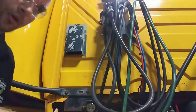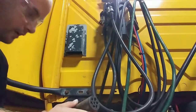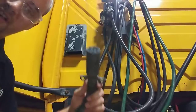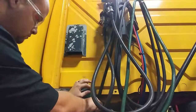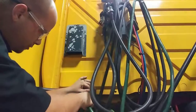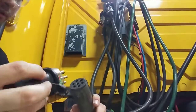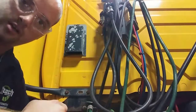I just did both the left-hand blinker and the right-hand blinker. What we're going to do next is plug that handy little device into what they call the whip of the truck, which essentially plugs into the trailer. We're going to take the male end of this light, part of this plug, and plug it into the whip.